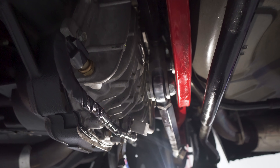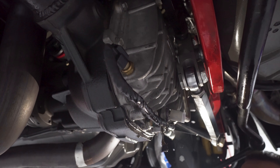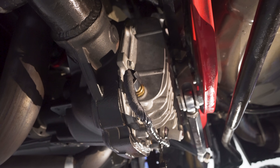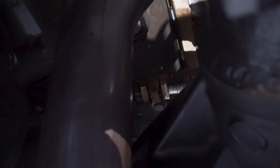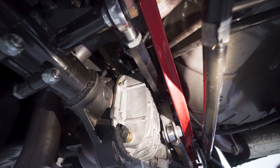With anything on these cars, they tell you put it together and then after so many miles you jack it up and re-torque everything and put Loctite sealant on there. But either there's not enough, we got contamination, or maybe it's just enough vibration — stuff's not totally bulletproof. What we're talking about doing for a solution is eliminating the adjustable link and going with a solid, non-adjustable upper control arm.